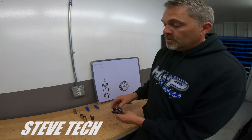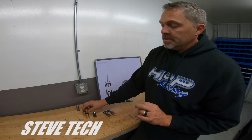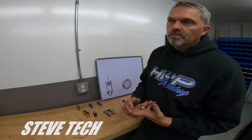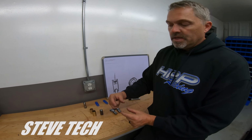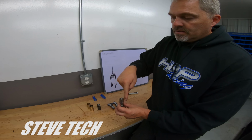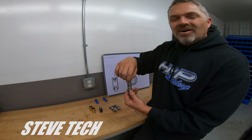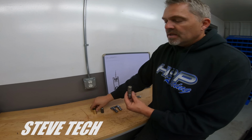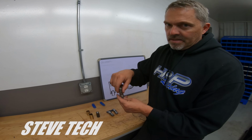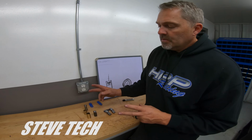Then let's go to the next style, which is pretty common, is a Keyway style. But before I go to the Keyway style, let's actually talk about the dog bone style, which actually has a plate that goes over a lifter. Instead of the tray, it actually has what looks like a little dog bone, like a little figure 8 that goes right here and captures the lifter. And remember, all that tie bar stuff, tie bars, keyways, slots, radiuses, that's all just to keep the lifter from turning when it's on the base circle of the camshaft. So there's dog bone style.